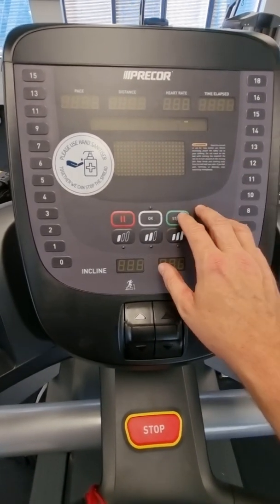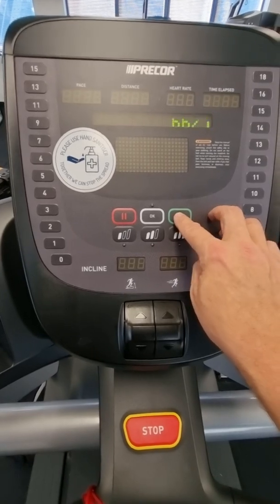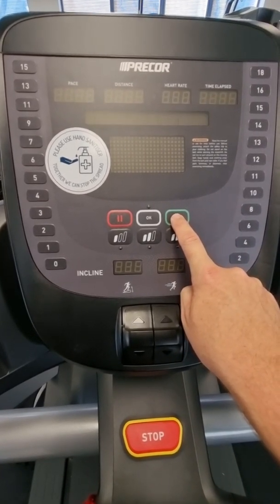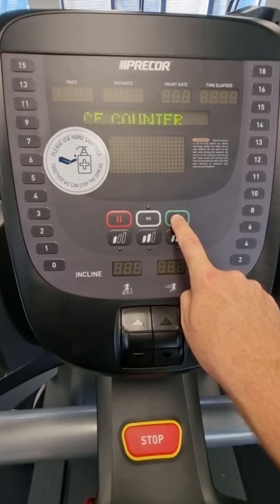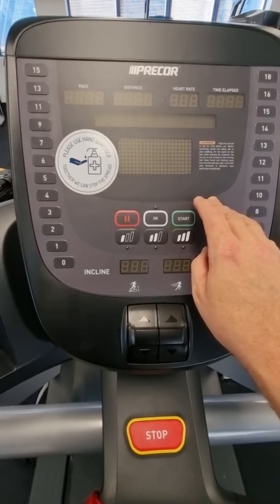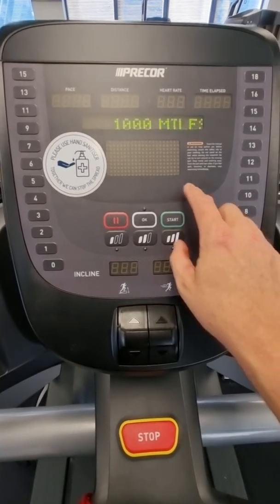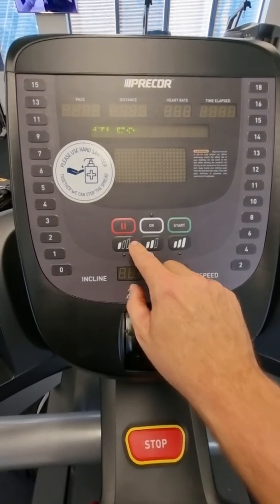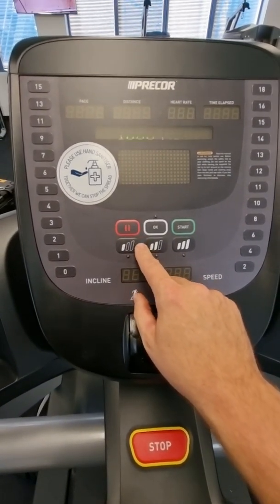To clear that, I'll just clear this for you here. If you press and hold the start button, just wait for all the words to go off the screen and then it actually clears this setting — back to 1000 miles.